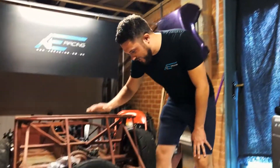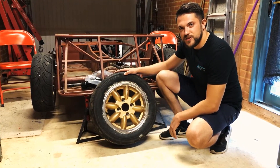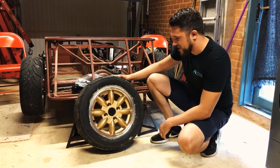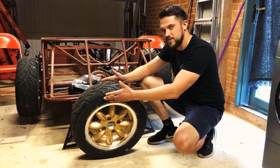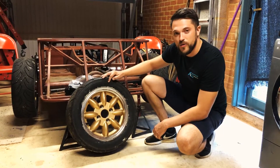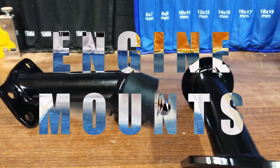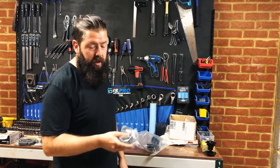The other things we've got are four wheels and tyres. We are going to get them sprayed a different colour to suit the branding of AE Racing. They have to meet the race regulations: 13-inch diameter and a maximum of 6J width, and they've got to be wrapped in AO48 tyres. We bought these as a kit from Kit Spares, where you can get quite a lot of the parts.